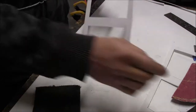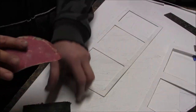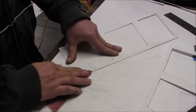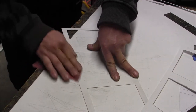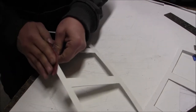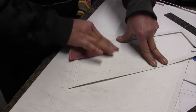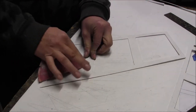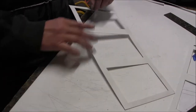And then when you cut it out, you're gonna have like little burrs. So I take sandpaper and just clean off the edges. And then the bottom, I just take some heavy sandpaper so the silicone has something to stick to. Really scuff it up. I've already gone over these pretty good. So yeah, emery cloth the front, sandpaper the back.